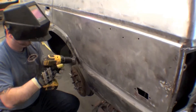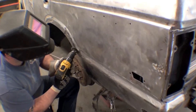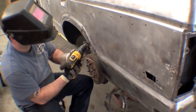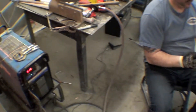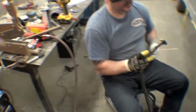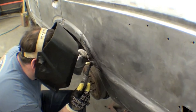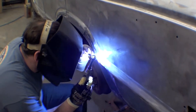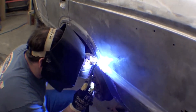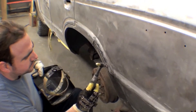What we're doing here is welding in the final panel and grinding it as we go. We use a TIG welder. TIG welding is a way of welding a panel in — there's MIG, TIG, and rod welding — and TIG is a good way to go because it doesn't create a lot of heat and makes for a very fine and detailed weld, such that you can weld thin metal and whatnot.